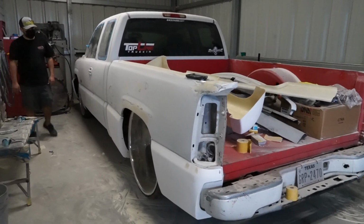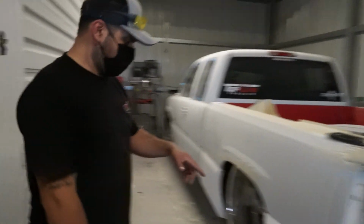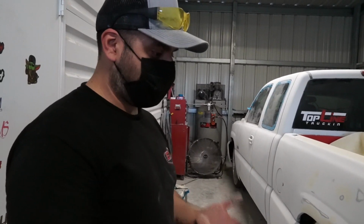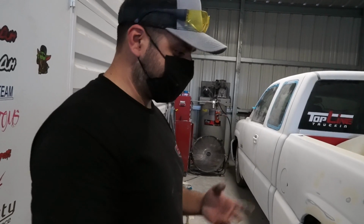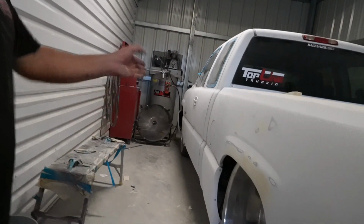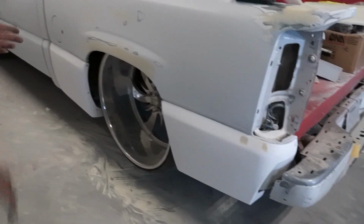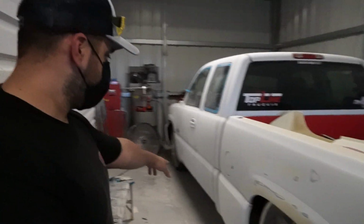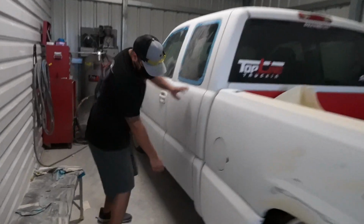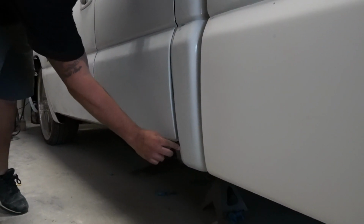Before, no? I think I've seen it. You can see, this is the same thing, 28. What we ended up doing, we actually redid the whole cladding, because prior it was done just with Bondo and rivets. So we installed it the correct way, aligned the body, and now you can see every single cladding is 100% straight. And on the rocker, OEM goes about here, so we added more material, and now it's gonna be flush with the cab corner.